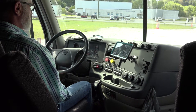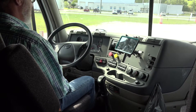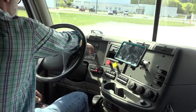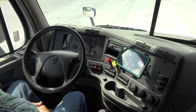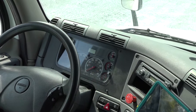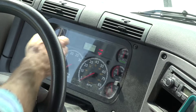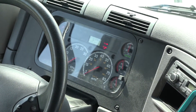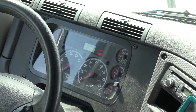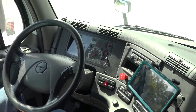I pump the brakes until my truck reaches 60 to 80 PSI or manufacturer recommendation. When it gets to 60 to 80, I will see a visual and audible warning. I have a visual and audible warning. Now between 20 and 40 PSI or manufacturer recommendation, my brake valves will pop out, engaging the spring brakes on the truck and trailer.